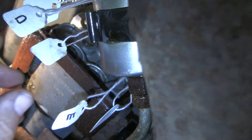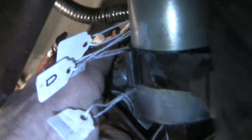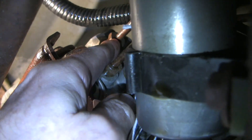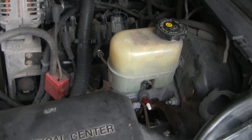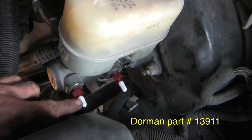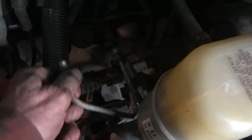Let me show you how far I've gotten. I've labeled each of the lines A through E so I don't get them mixed up. I've got one of the nuts off — it came off with a 9/16 flare nut wrench. These plugs are from the Dorman kit for bleeding the master cylinder, and these little white things are 3/16 caps I got separately. I've pulled the lines off and I'm working my way down, labeled as front and back, pulling them loose to get them out of the way since some connectors are very hard to reach with the others in the way.